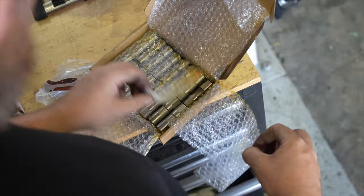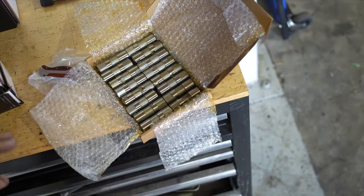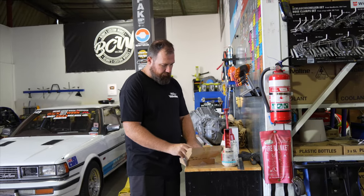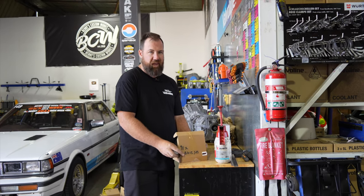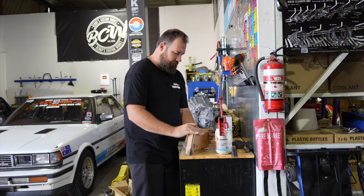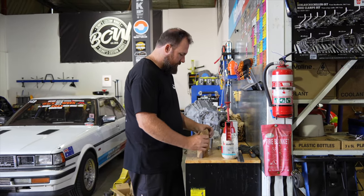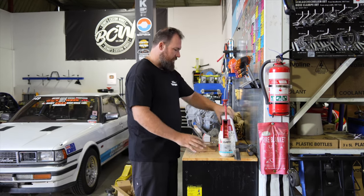Kelford say these are good for about 7200 to 7300 RPM — so the whole package is good for that. Having really good springs is a lot to do with being able to control the valve train and it not running away, because valve float or uncontrolled valve will definitely damage push rods, lifters, and the cam. With a push rod style V8 where you've got a lot of valve train parts moving, having so many more moving parts means it can definitely get away from you.